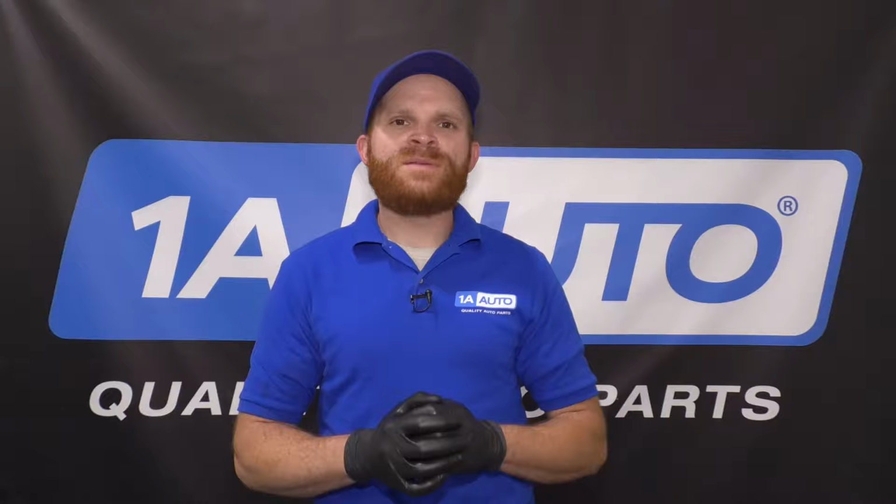I'd like for you to always try to keep in mind to check your oil level. Just going by the maintenance schedule isn't always going to be helpful because a lot of times the maintenance schedule can be stretched out for a long period of time, and what you're going to notice is the engine goes through oil in a much quicker amount of time. So just get under the hood, pull the dipstick. If it looks like it's low, go ahead and add a little bit of oil until it gets up to that full mark. Don't go anywhere above that.